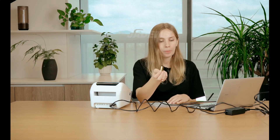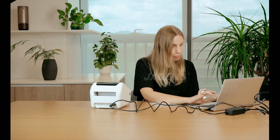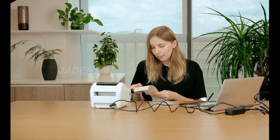Now we need to plug in our U-Disc to download the Seagull driver for the printer. Then go to Settings, then Devices, then choose Printers and Scanners, and choose your printer. Then we need to choose the printing preferences, which means we need to choose the page size — four by six inches is correct. Then print a test page. And now we have the label here, which looks very professional, and you can stick it to your package directly. And it's done.